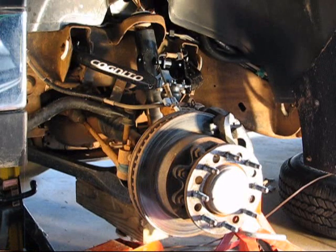We have the Cognito arm in there now — it's all installed and snugged down on top. The next step is to tighten down that upper ball joint and get the spacing right with the spare washers supplied in the kit. Once we do that, we'll get the brake lines cinched down and get the front shock installed.